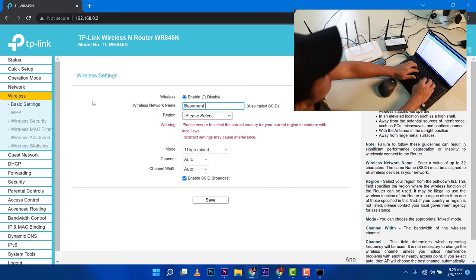The last thing I need to do is disable the DHCP server. Why? Because your ISP router already has a DHCP server. If this router also has a DHCP server and we connect them together, you'll have a conflict. In one network, you should have only one DHCP server. So go to DHCP settings, find that option on your router, and disable it. Once saved, you may be disconnected. We can then check that we should see 'basement Wi-Fi' in the available networks.